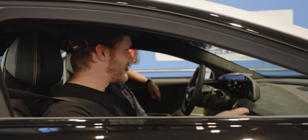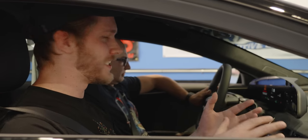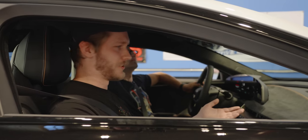The car is getting really mad at us — it says there's a brake system fault. This is very common on a dyno just because your front wheels and rear wheels might be spinning at slightly different speeds and the electronics get really mad. This is common not only in electric cars but any modern four wheel drive car.